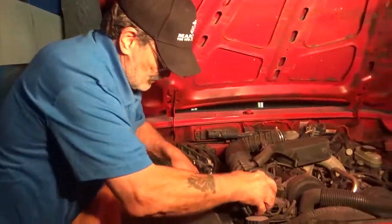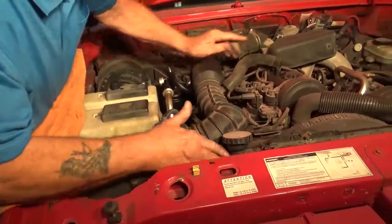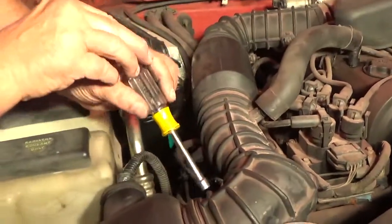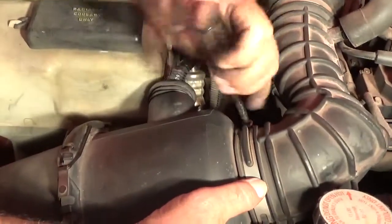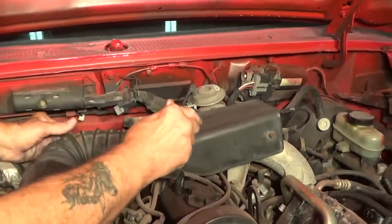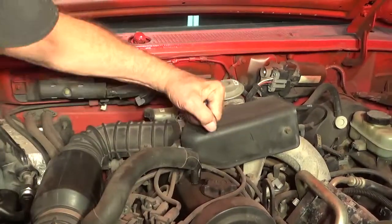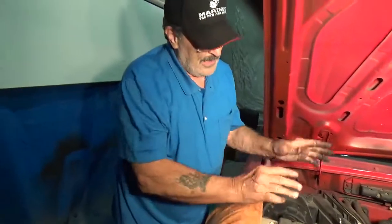Now we need to replace the fresh air intake here. Slip it back over — we haven't harmed anything, we haven't disconnected any wires. Slide it up on it good. Grab the trusty little 5/16ths again. Locked — that can't come off when we're driving. Snug them both. You're in business. Now you're ready. Now you need your little bottle of Freon — pop her on there, air it up, you've got air.